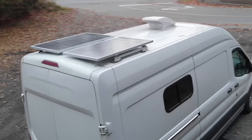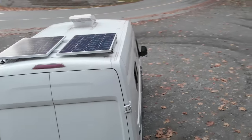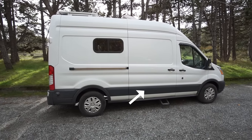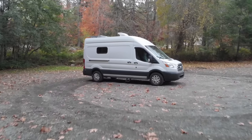One of them was the top brake light in the back — the seal around it didn't seal properly, so we had to caulk all around the brake light and that fixed that issue. Also, all the pegs that hold the plastic cladding on the outside of the van were not sealing properly and water was coming in through those too. So we caulked all the pegs from the inside.